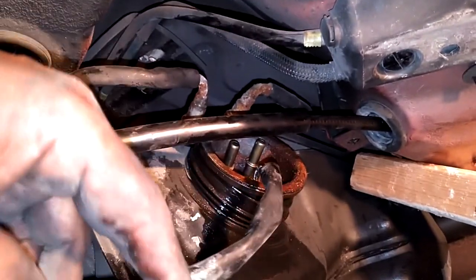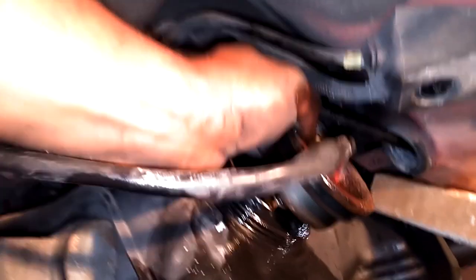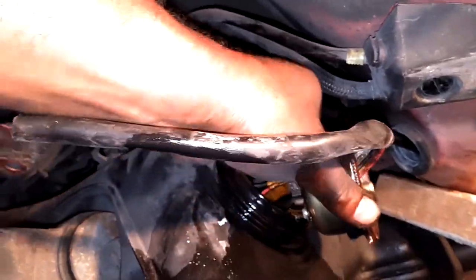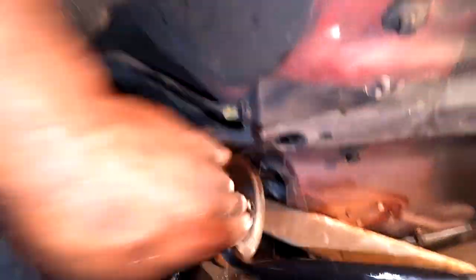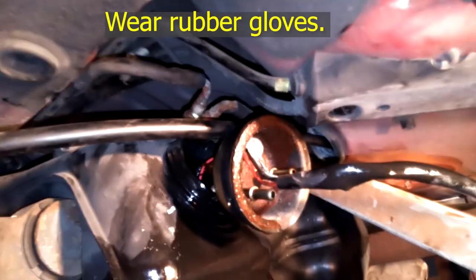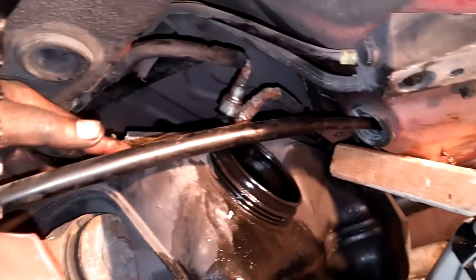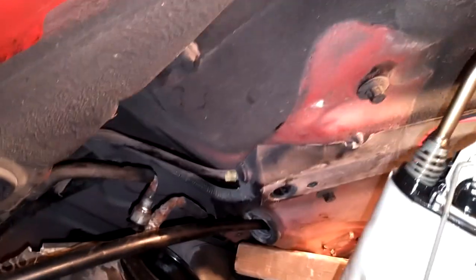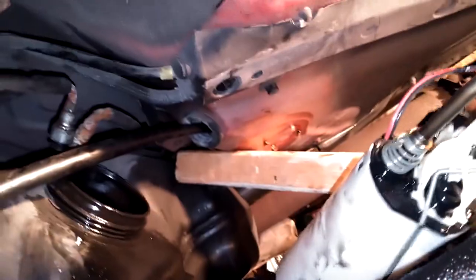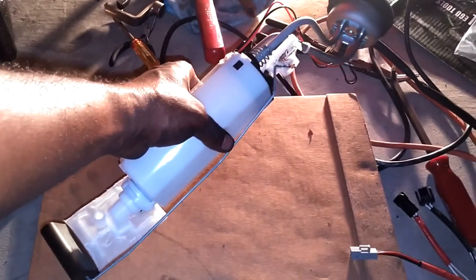Get the wire pulled down through here. Now you've got to lift the sending unit out and pry the tank down far enough to get it out — but you can maneuver it by wiggling it around. It was actually a two-person job: I pried the tank down while he wiggled the sending unit out. That's the old pump sending unit, all that stuff.